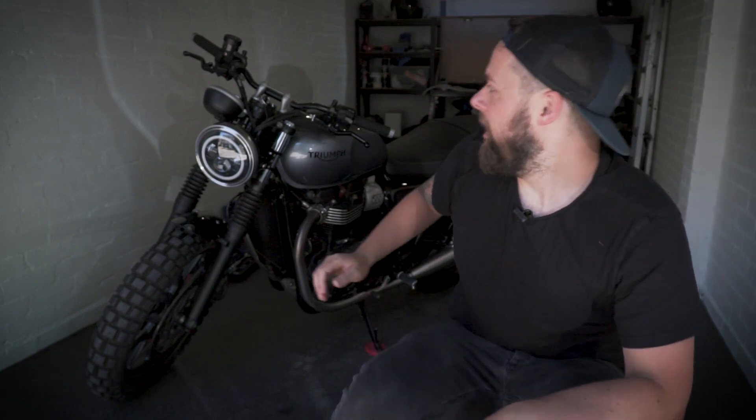I'm really happy with how it looks — it makes it look a bit more modern, and a big part of that is the angel halo around the outside. Unfortunately you do have to splice onto the cable for the original sidelight because there's no universal connector — Triumph have made their own specific connector. There's also no separate earth for the halo light because everything on that LED unit is earthed through the main bulb connection.